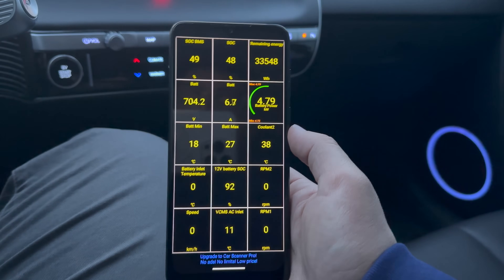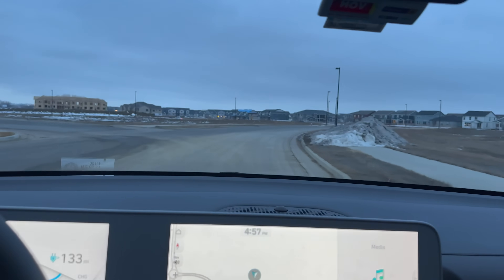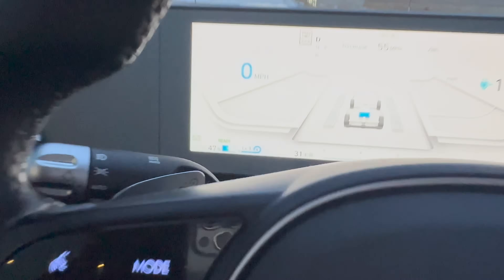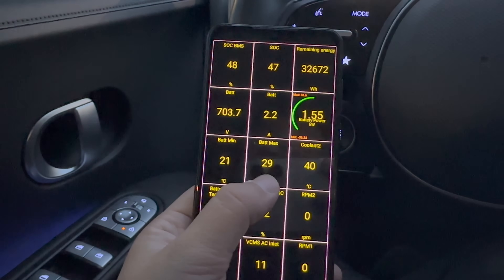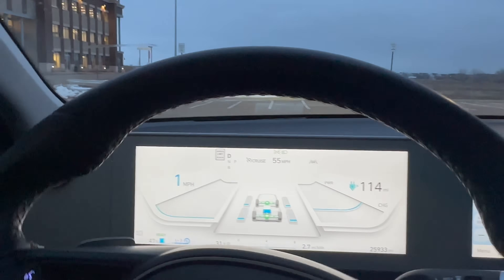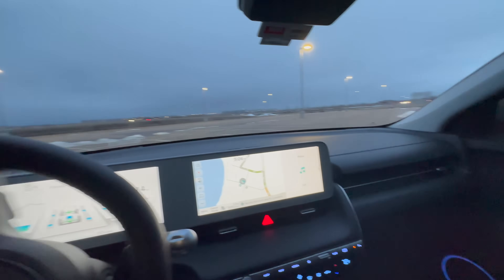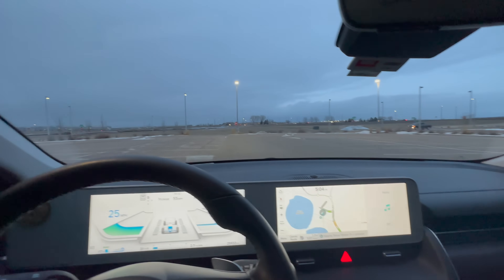What's really weird is there's no noise — can't hear any pumps going, can't hear any heating. The preconditioning icon is still on. I've just stopped the car because I noticed the snowflake went back to the zap icon, and we've reached 21 degrees Celsius on the minimum, 29 on the high, and coolant temperature is 40. We're only 1.3 miles from the EA station, at 47% state of charge — this car should still be able to charge pretty fast. Let's go try it out.